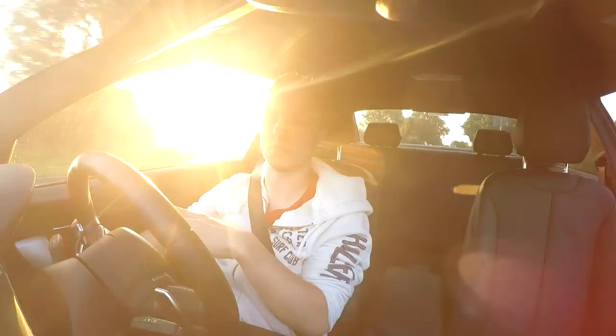And the reason for that, again, my understanding, is that if we're going along in 5th gear and we're at, say, 5,000 RPM, which is somewhere around what I was doing, and then if you were to shift to 4th gear, you'd be at say 6,000 RPM, 3rd gear you'd be at about 7, 2nd gear you might be at like 8 or 9, which is past the limiter, so normally you wouldn't be able to do that anyway if you just drove in 2nd gear and floored it. But basically, the revs are going to be way higher than they were before.